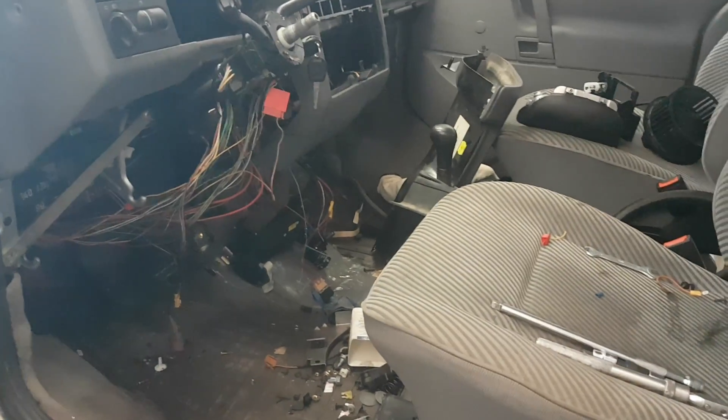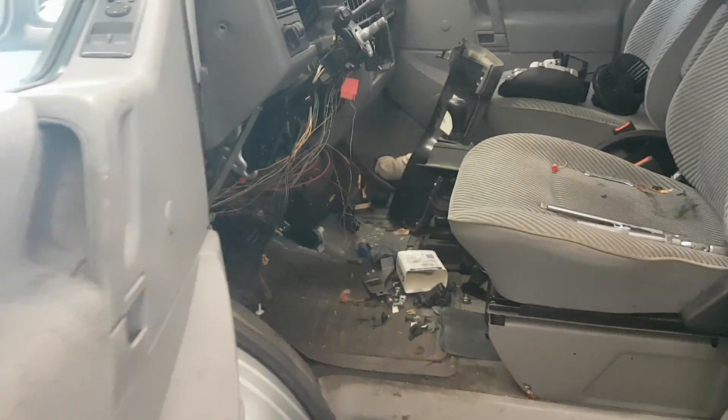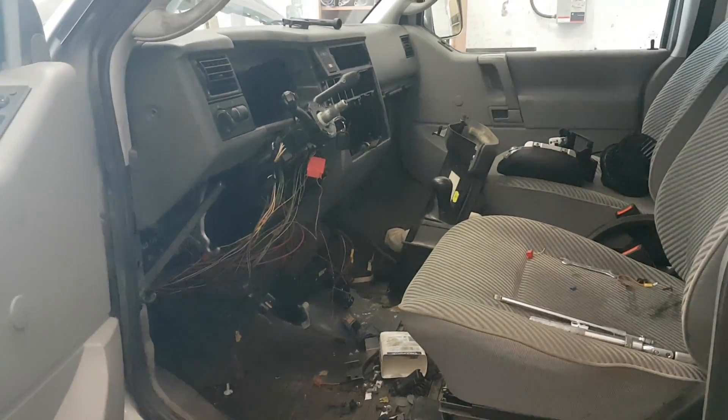What's really interesting is I don't think I'm going to use the ABS system. I still have the ABS module, but I'm not retaining it — because the CV shafts in this thing didn't work out. Some were too long, some too short. There's a tone ring on the actual CV shaft for the ABS sensor. I could get the correct CV shafts down the road, but for the time being I just want to get this thing running, driving, and going.